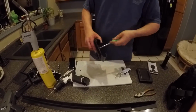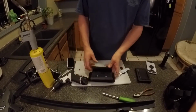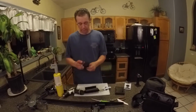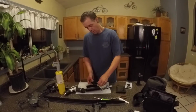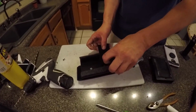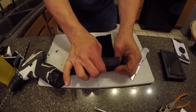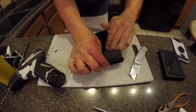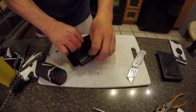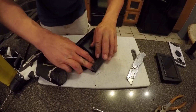And just remember, this doesn't have to be this small screen. This can fit any size screen you guys want to do. So after that's done, you're 99% done. You literally only have to put on the Velcro. The Velcro, I can say, is kind of tricky, but what I'll do is I will kind of give a flare over the edge and kind of get it halfway in between to where I know I'm going to have enough. And I just work all the way around the curve, and I get that flare up. Now I'm going to knock that down with a fresh razor knife as soon as I'm done and go along that edge and cut it flush with that edge.